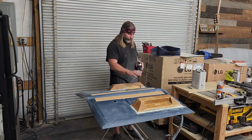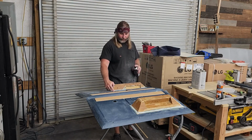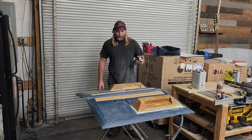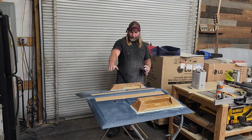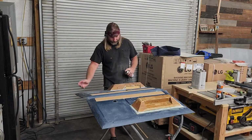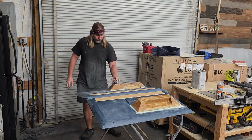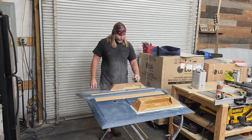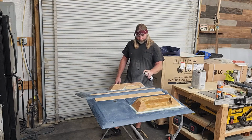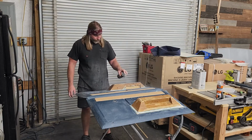I'm only going to spray the trim piece up here and the door handle. I'm not spraying it all over everything because you don't want to have to get in all these little nooks and crannies and sand this stuff back down. I just need to get these spots where I body worked it and get this MDF covered up and sealed up. So probably put about 2 coats on here, and hopefully that'll build up enough that we can sand her down and smooth her out.